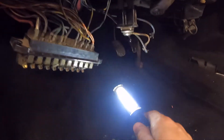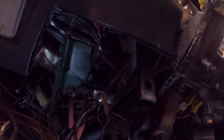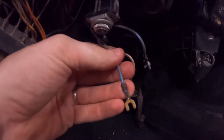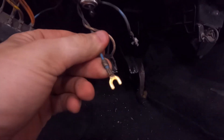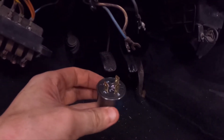So we're going to get here under the dash to where the flasher indicator relay is for our turn signals. It sits in this little silver clip up there — you can see it right there. It's two little hooks and it just kind of slides into there; there's no retainer, just the clamping force holding it. So that's these three wires: there's a blue and black, a white and black, and a solid blue. The blue and black is our power in, white is our left blinkers, and solid blue is our right blinkers. But as you can see, these terminals are not the right kind — our new one has regular male-receiving ones but our previous one had screw-in type. So I'm going to replace these terminals so they'll be accepted into our indicator.